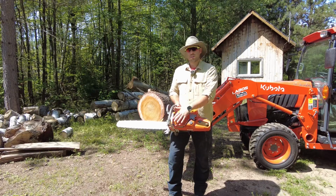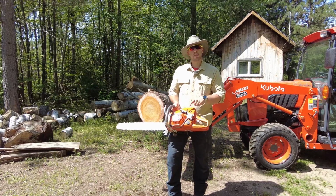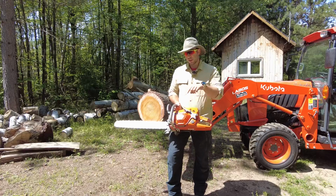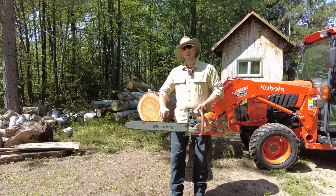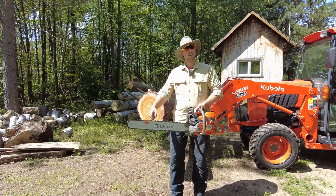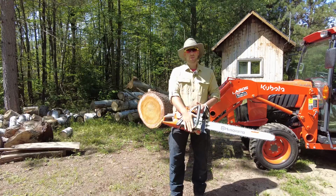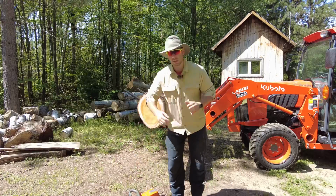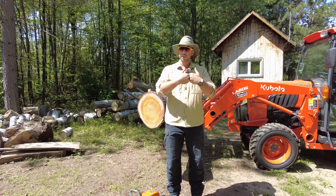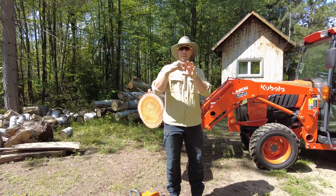Now, I don't know, I rechecked the footage quickly. I don't know if it shows in the YouTube video when I unbox this chainsaw, but basically when I started the first time with the chain brake off, the chain was spinning slowly on the chainsaw. Why is that? Because there's a clutch here, a centrifugal clutch, meaning that as this clutch spins, there's a spring that is holding the clutch in. It's spinning inside of a container.